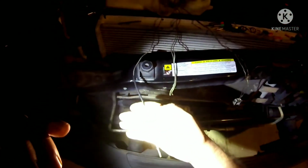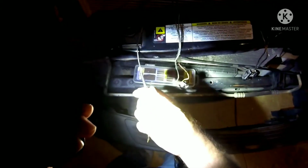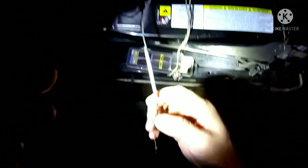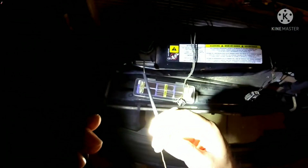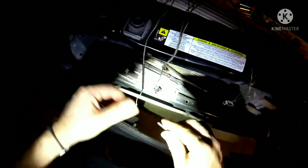Alright, after about maybe 5 minutes of tinkering, this little silicone bushing that goes on the back of all these pins, as you can see right there, I folded it inside out to get it off of that pin. But what I'm going to do here is I've already run up some heat shrink, and I'll show you guys how this stuff works real quick. It looks as though the rest of the wire on this strand looks good, but this part right here is bad. So I'm only going to be using 2 pieces of heat shrink. So let me show you how you put these things on.